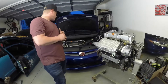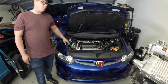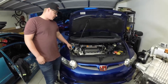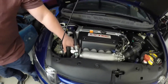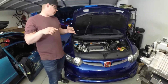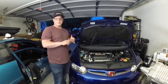In the next week or two we'll be tearing apart this car to go ahead and put this kit on there, and we should have some data for you as well as additional videos as we go through the install. There are some slight tweaks that need to be made — we went over the thermostat and thermostat housing, and we also need to clearance a little bit of the water pump housing on the backside near intake runner number one. Other than that, I think we've covered just about everything. If you have any questions, want any advice, or if I missed anything, go ahead and comment below. Don't forget to like and subscribe.